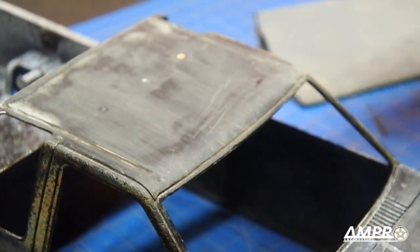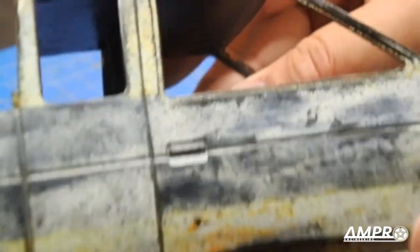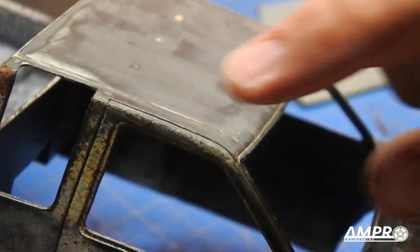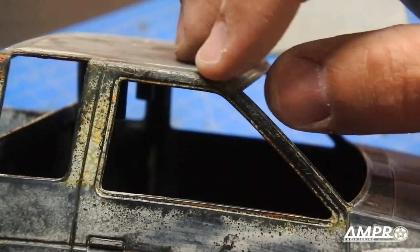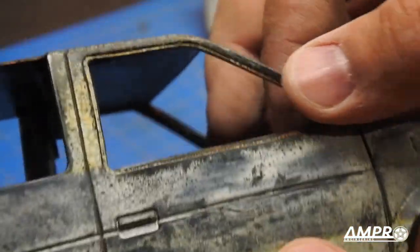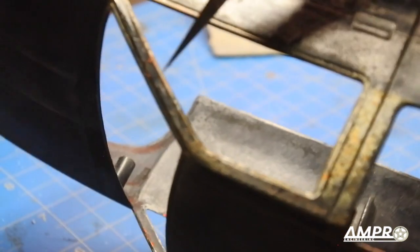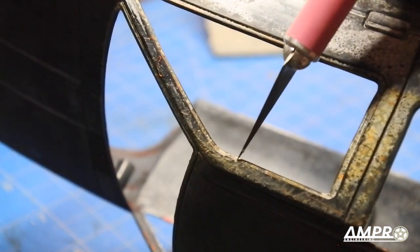I'm making some good progress — the roof is a heck of a lot nicer than I had anticipated. There is definitely some road rash in these areas, and my opinion is: do not start sanding until you've smoothed the surface out a little more and sprayed the car down with some white surface primer. There's quite a bit of material missing in this area, and sanding until smooth is going to do nothing more than further deform and thin it. Instead, focus on the trim. I'm running the exacto knife gently in here — this one has a broken tip, giving me a more blunt surface — just to clear out some of the residual paint.